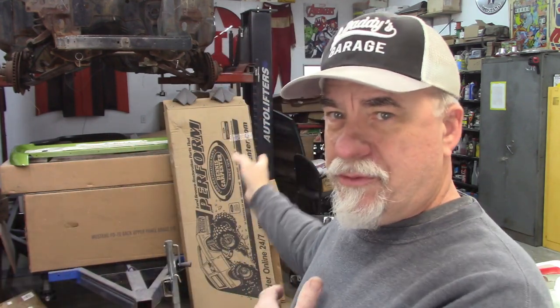I currently have the mini split running with the heat mode on, trying to get some more heat in here. Unfortunately, with the process, you'd have to have airflow. I think a lot of people think you just spray paint in a controlled or closed space and it's all good, but it's not. You have to have airflow to help it dry and also to remove overspray. So when you have movement, you also sacrifice heat. So I'm gonna have my windows open on the side here to let air in, and it'll go out through the fans. So it's just a sacrifice that has to happen. Hopefully it all works. So let's take a look at what I'm painting with and how the Bronco looks right now.